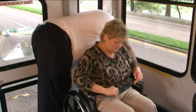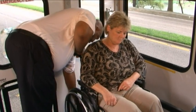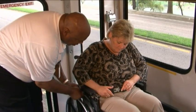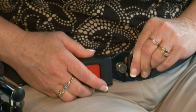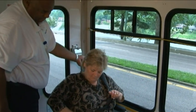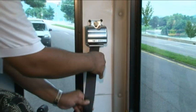To fasten the lap belt, extend the wall side belt to the aisle side area, placing the buckle near the occupant's hip. The belts should be under the armrests on the mobility aid. Extend the aisle side belt and connect together. Pull on the belt to ensure it is secured. Pull the shoulder belt from the wall side retractor and fasten the lap and shoulder belt together. Pull the belt out gradually to not engage the auto locking mechanism.